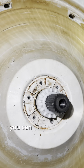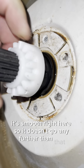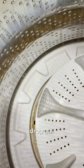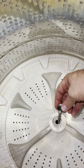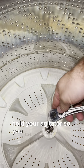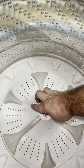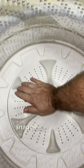With a little force and a little hammering, you can see it's on all the way — flush all the way down to the bottom of that shaft. It's smooth right here, so it doesn't go any further than that. Then we just reinstall our cap, slide that on, and get your screws back in place. We've got that part screwed back in. Drop the agitator back in — again, line up the teeth and it should slide right on. The nut with the washer, throw it back in there. Put your ratchet on and hold your agitator so you can tighten it on properly, otherwise it'll just spin. There's no need to necessarily torque it — just until it seats. Take your cap — it tends to line up a certain way, so spin it until you can get it, then snap it back on.